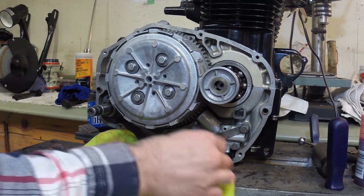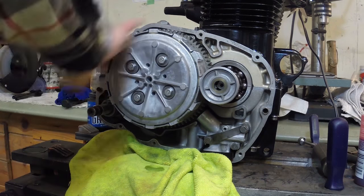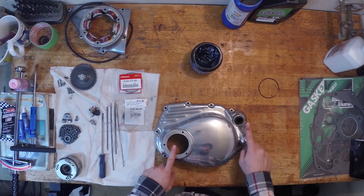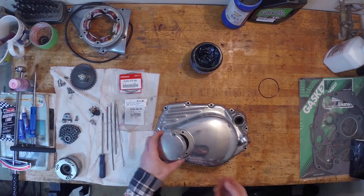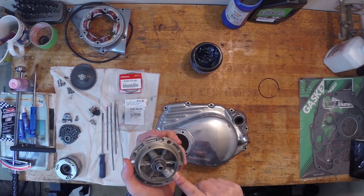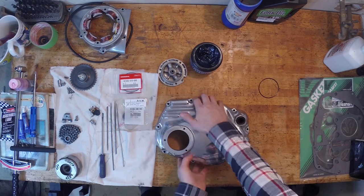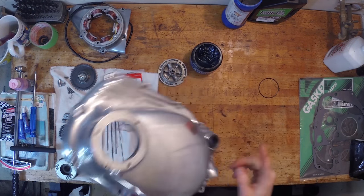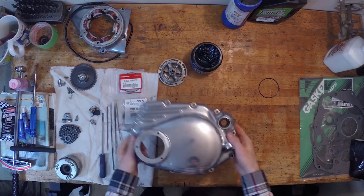It's looking good. Some final oil is squeezing out of here, but overall feeling pretty good. What I need to do next is replace these seals. There's a seal and an O-ring in the cover for the oil slinger that needs to be replaced, and within the side cover there's an O-ring that needs to come out. Also the kickstart oil seal right here needs to come out.